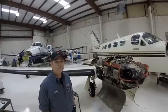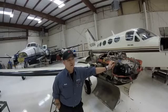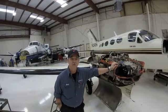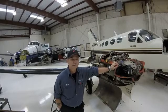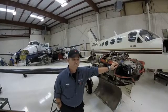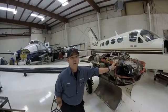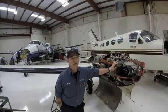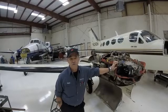So now when you see a Continental engine, is that something you're going to be on the lookout for? Lately I have been. We had an issue a couple of years ago — a guy wanted to do a pre-purchase on a Bonanza, and in the logbook they had actually been documenting that they were finding iron in the oil filter. Samples showed up as iron. So we planned to pull some lifters out — it takes about an hour per cylinder. The first lifter I pulled happened to be the bad one. We pulled the engine out and sent it to Continental. It was just a little out of warranty, but Continental warrantied it for us. They changed the camshaft, put new lifters in, and sent it back. It's just a repair — it doesn't go back to zero time since major overhaul — but we haven't had any trouble with that engine since.